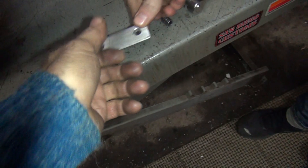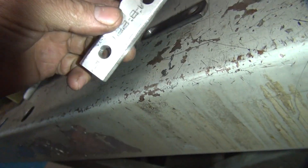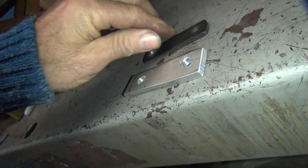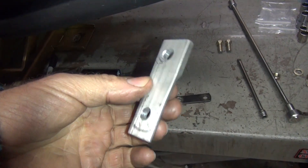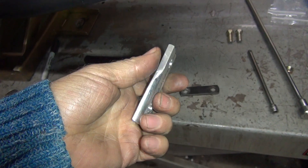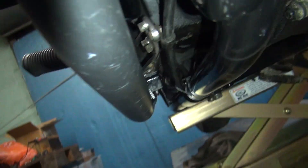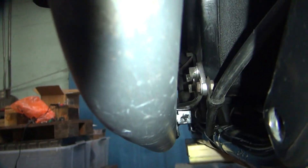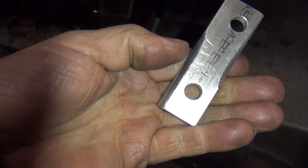So this is the original one, this is the new one. It's 3/16", quarter inch, three-quarter wide, one inch wide. This is 6061 aluminum, this is steel. Aluminum will not break like steel does — it's bigger and stronger anyway. We put a twist in it to make it fit the uneven heights of the two pipes up under there. They've got a twist in them. And we filed the plate down to fit next to the exhaust better.